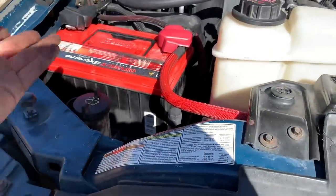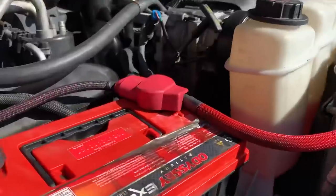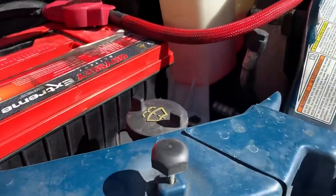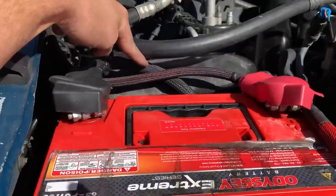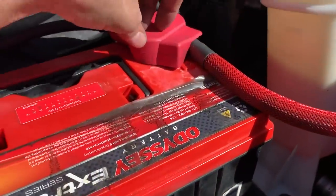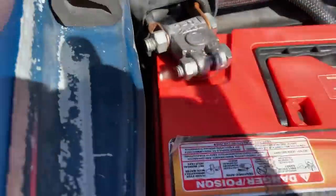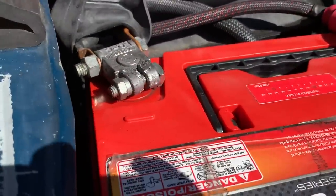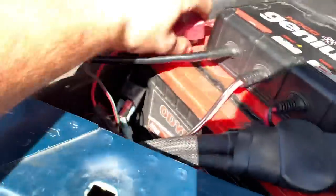These batteries are freaking awesome - night and day difference. From the first crank I've ever cranked till now, I've never had a complaint. Well worth the money - I hope I get eight to ten years out of them. And then I've got my own custom terminals and custom battery cables. I stepped up a size everywhere - I think it's two-aught or double-zero. This is the one that goes to the starter, so that's really important. These nice terminals are great - no corrosion, bolted tight - because the factory cables are freaking garbage.